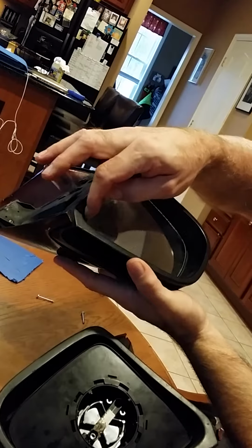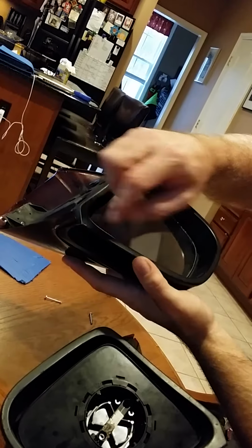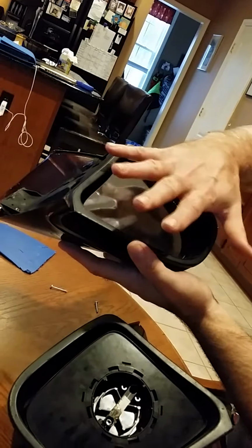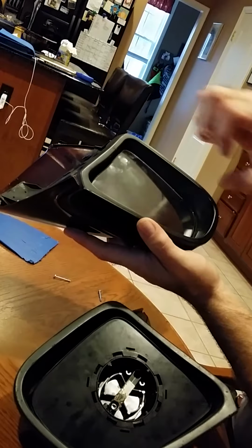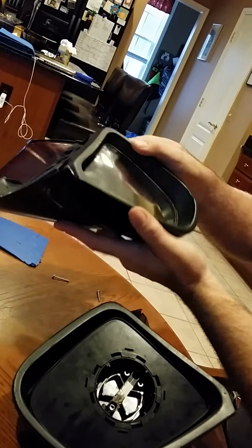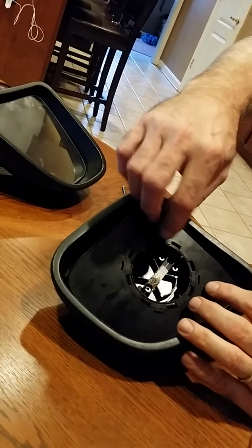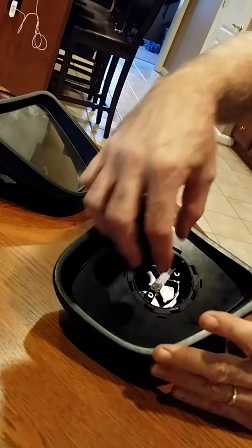Again, you need to take apart the mirror assembly from a K1200. Very carefully remove the mirror glass. It's just stuck or laminated onto a plastic backing plate. I would heat this up thoroughly and carefully peel it off very carefully. Cover it with tape. Once you get that off, you'll be left with an assembly something along this line with a hole in the middle to get at the screws.